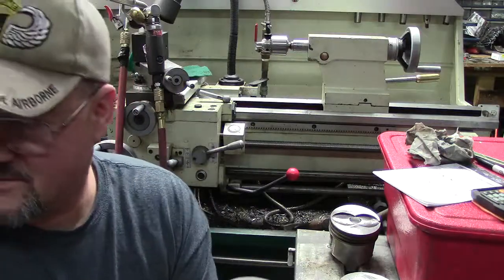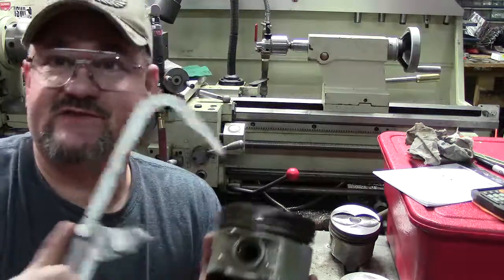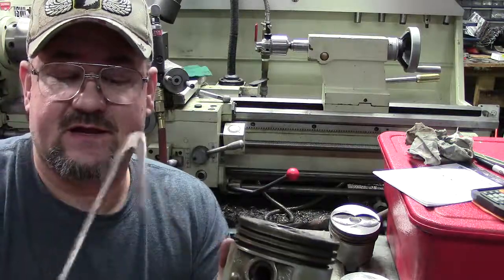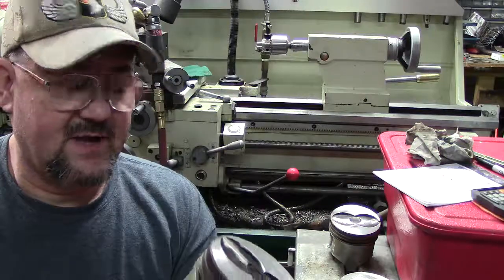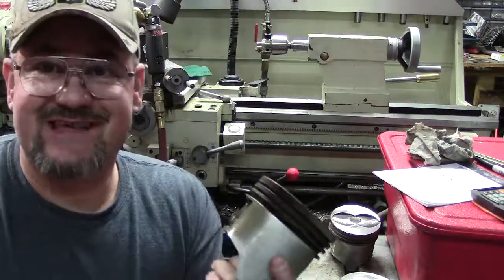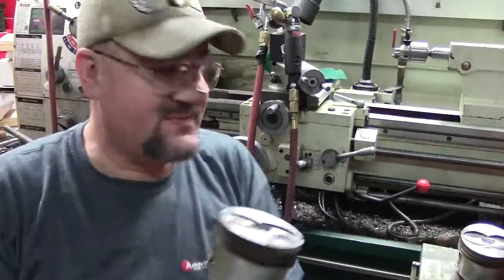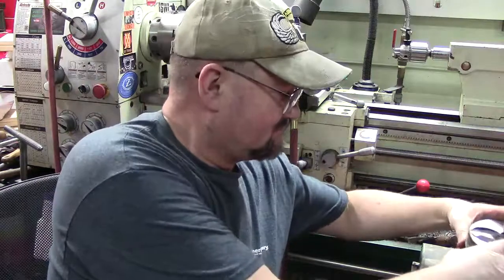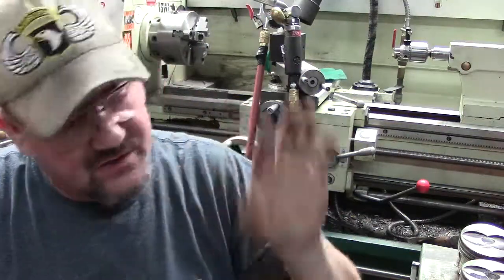I've got a piston groove cleaner. We're going in, cleaning all the grooves on the pistons. There's lots of videos out there on how to do that. This is pretty old and worn, but it's still doing the job. And then also we're having to go in with a little pick as well, to make sure. Simple things that you're doing on your own budget rebuild. Again, nothing fancy, lots of stuff out there. When I get into the heads, I'll show you all that.